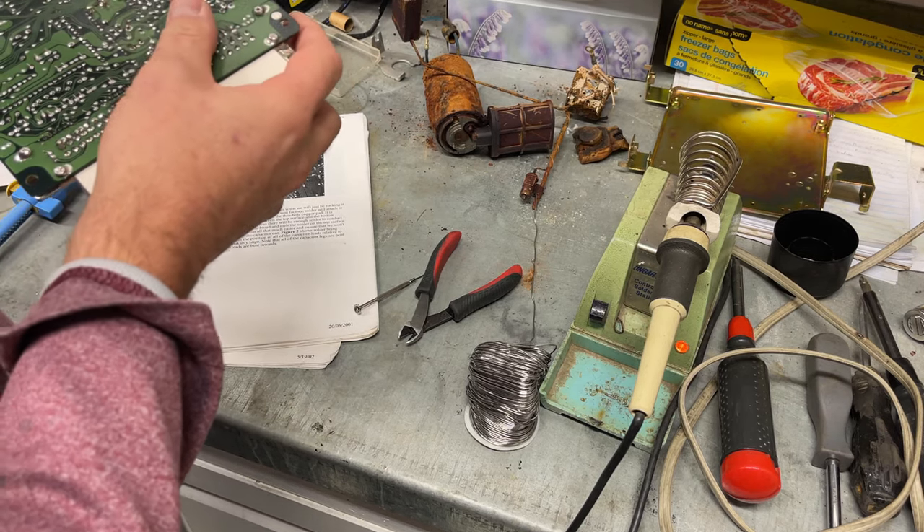Before I put this repaired ECU in, I'm going to run it with the known-good ECU first. I can still communicate with this one, which is nice. I'll put it in logging mode just to log while I'm doing this, and make sure the car starts with the known-good ECU. Starting the log — and it does start. So we're good there, it's running.